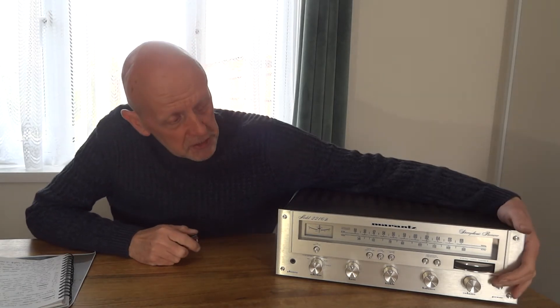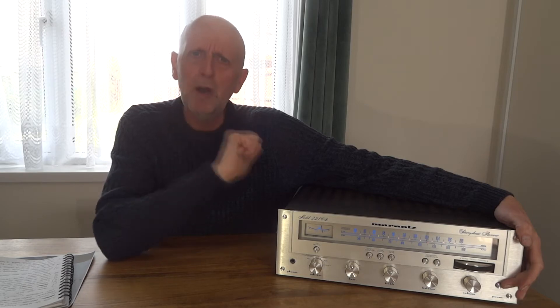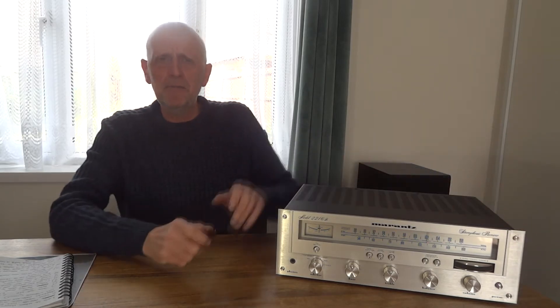What was happening is I'd turn it on and — more noticeable on the radio really — you'd hear interference, thinking you're getting static or noise coming through, like someone next door mucking about with a drill. What I did notice, and you'll see in the video, is that as I turned it on and off the backlight dimmed a little bit — giving you the idea that it's not making a full contact and something isn't right.